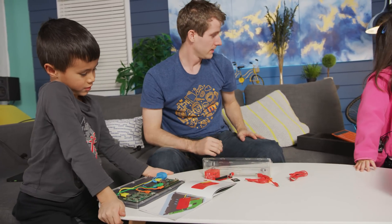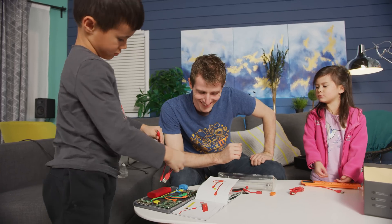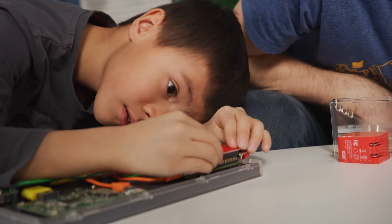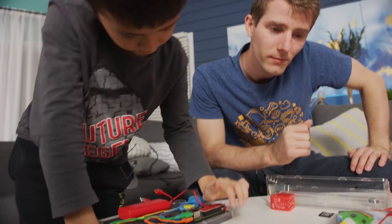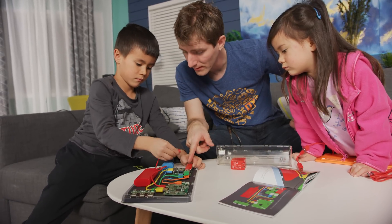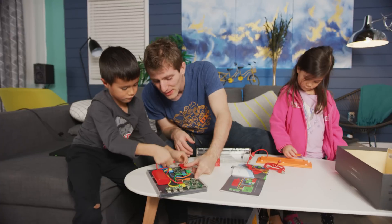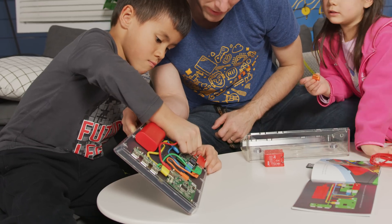Now you need the battery. Can you bring the battery over? The keyboard's on the battery — is it still charging? No, because it's not plugged into the battery anymore — that's how it charges. Make sure it covers all the pins. You've got to look at it because it's keyed, so it only goes one way. Look at the shape. Check the slot you're plugging it into and make sure you're putting it in the right way. No, you're still putting it in backwards — hold on. There we go.